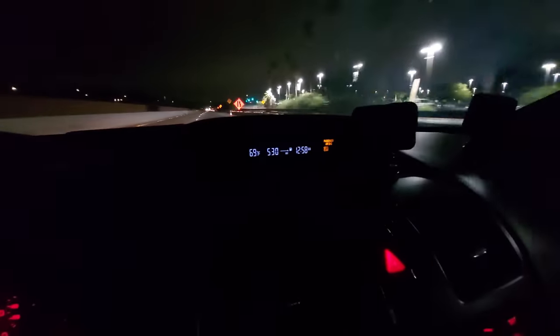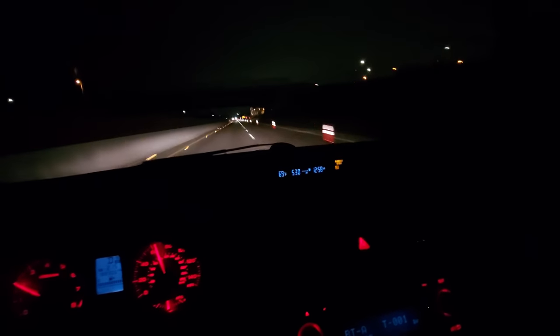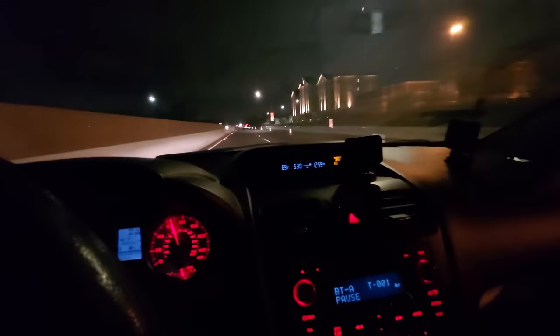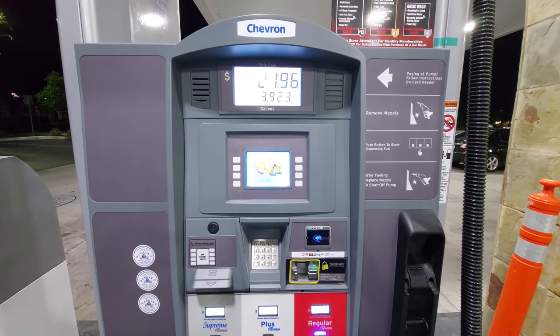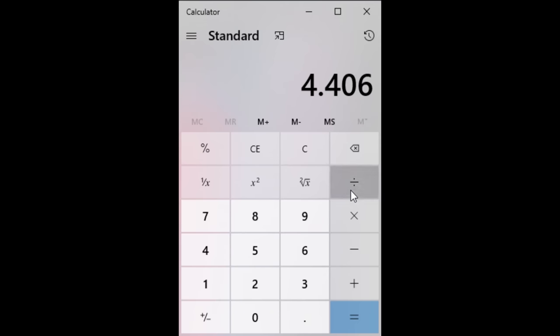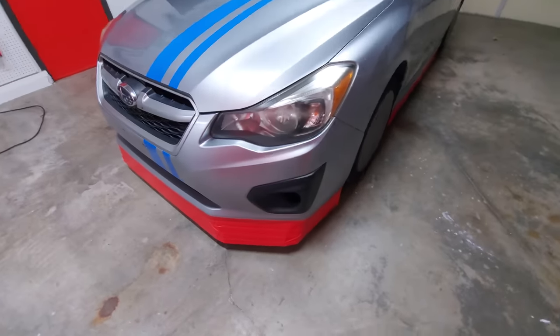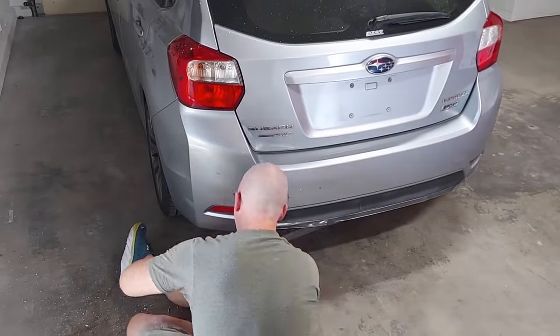Then it was time to hit the road with the skirts, wheel covers, and roof rack taped off. The trip indicator showed I'd already lost about 30 miles after only 20 miles driven, and my average efficiency looked pretty low. It kind of felt like riding on a giant vacuum suction hose — very stiff, like I had more grip. But when we got back to the pump, it actually represented an 8.3% increase in efficiency. It would appear that pushing the air around the car was more beneficial than the loss due to increased frontal area.